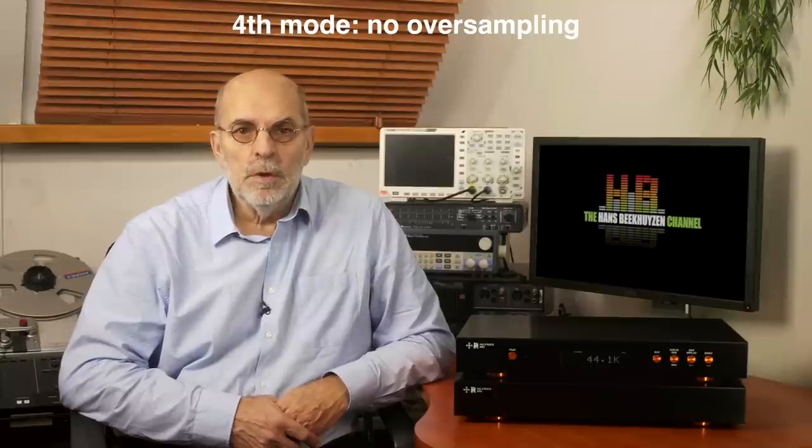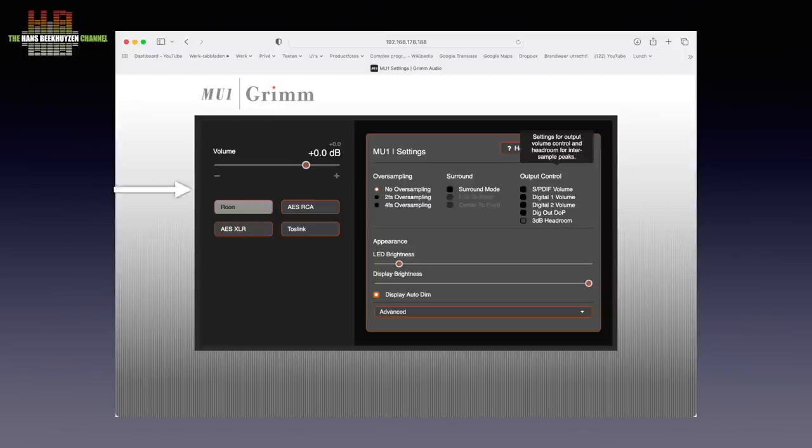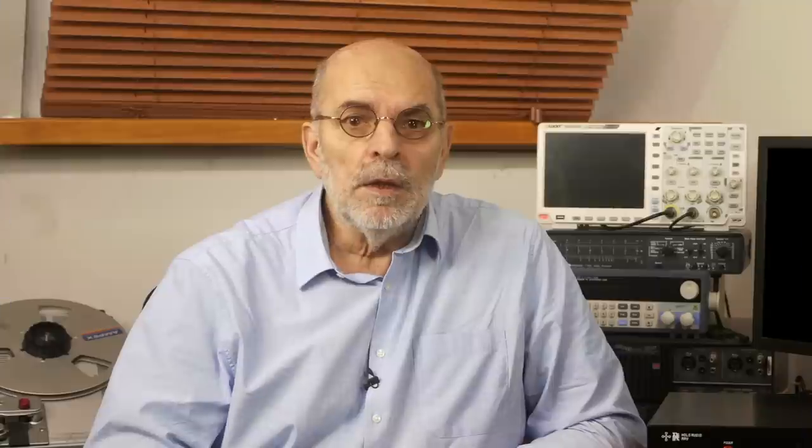The other option is to choose upsampling or not. The May offers three upsampling modes: upsampling in the native format (DSD stays DSD, PCM stays PCM), upsampling both formats to PCM, or upsampling all signals to DSD. All four modes can be selected on the front panel or from the remote. Switching between oversampling modes is instantaneous, but switching back to non-oversampling takes some time to settle, as the AKM async upsampling chip is no longer in the signal path. I tried all modes and concluded non-oversampling would be my choice, with upsampling and 3 dB headroom switched off in the Grimm Audio.